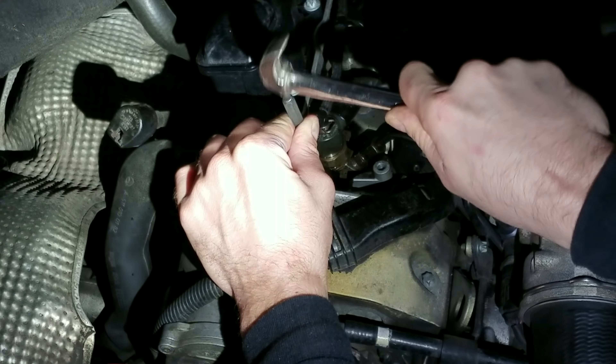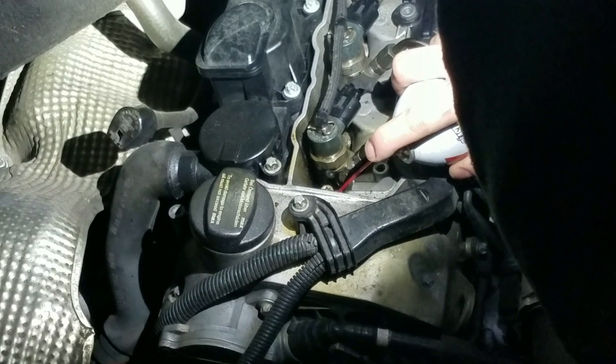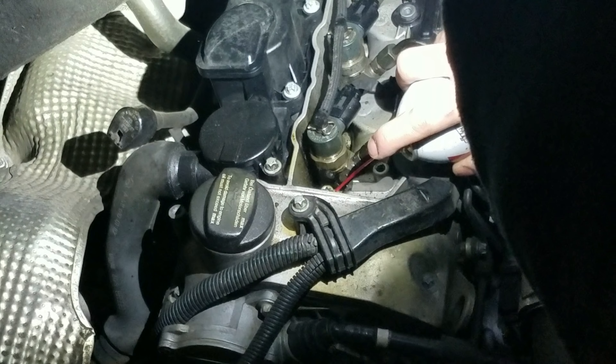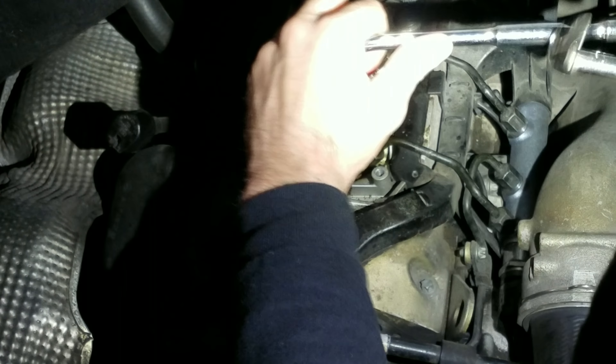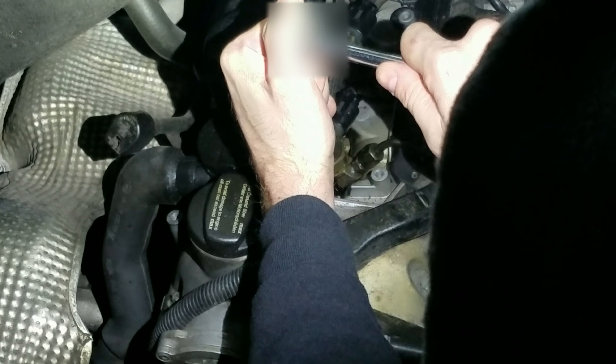Now we can crack that loose. I'll do about half a turn with taps and then I'll tighten it back up, just because there might be sludge in the threads. You don't want it building up and then having the bolt break, because this is an aluminum head. They do that for weight and cooling, but that also makes it extremely fragile.